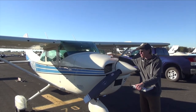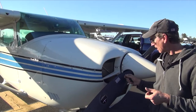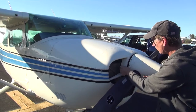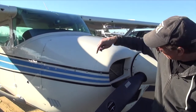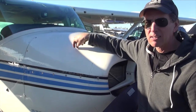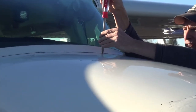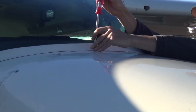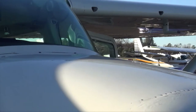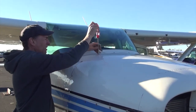I think it's really cool to see an engine beneath the cowl. Right now I'm just taking off a couple bolts that fit right here on the nose cone, and then there'll be these quick releases here that I'll take off as well, just to get the top cowling off. Now I'm getting these quick releases on the top part of the cowling, and then I'll come around to the other side and continue to take these off.